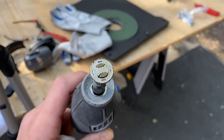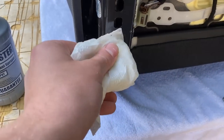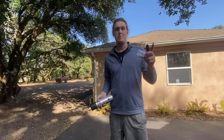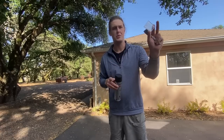That went through literally an entire cutoff wheel on this thing. When you're left over with these little pins you can do something fun like make a necklace out of them — maybe if you're ambitious you can have your dentist install it. You want to clean them off with a little bit of isopropyl alcohol just to get any remaining dust or potential grease. At this point we want to cover that bare steel with a little bit of Rust-Oleum so that it doesn't rust over time. I use this stuff in the can — link in the description below. I just spray it into a little cup and then use a paintbrush to paint it on.